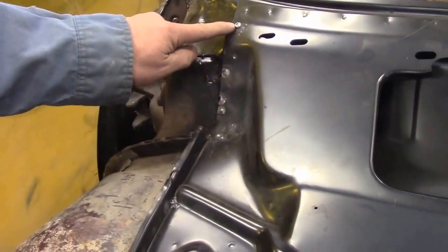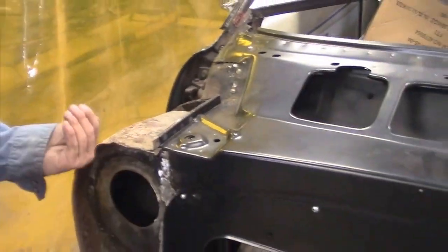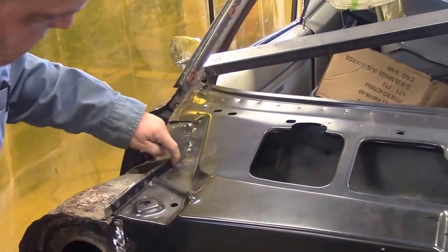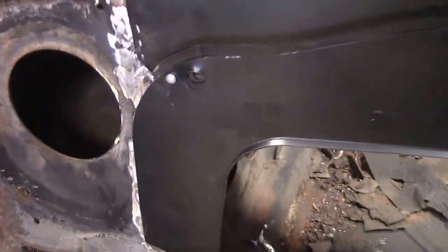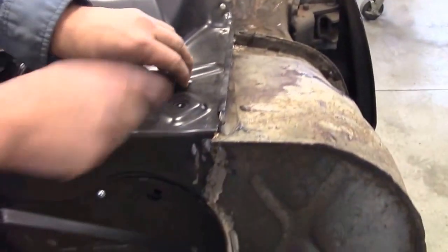We've got some screws here — we basically dry fitted the whole cowl in place and then fit it from underneath. We've tack welded it in place, and you can see how nice these seams are — everything lines up as it should. From the passenger side you can see where the piece has been welded and we've ground all those spot welds smooth. We used the exact factory spot weld holes when we drilled them out and welded them back in. Same thing on the driver side — you can see some self-tappers here.